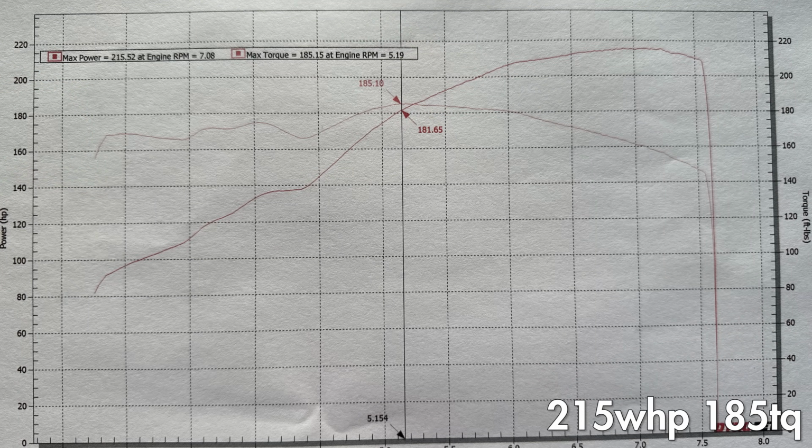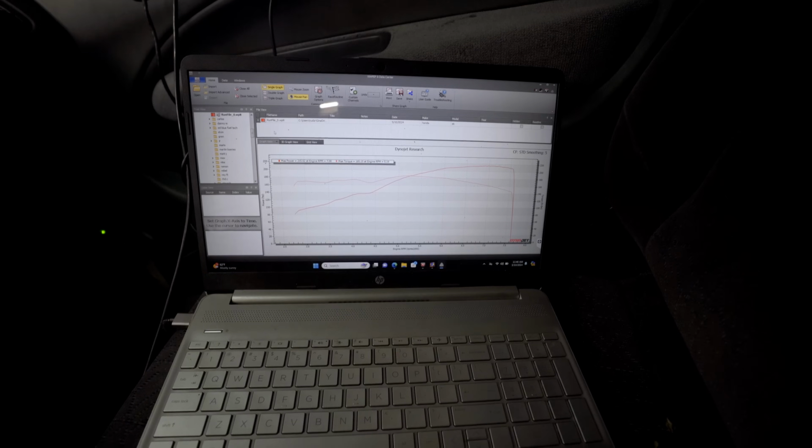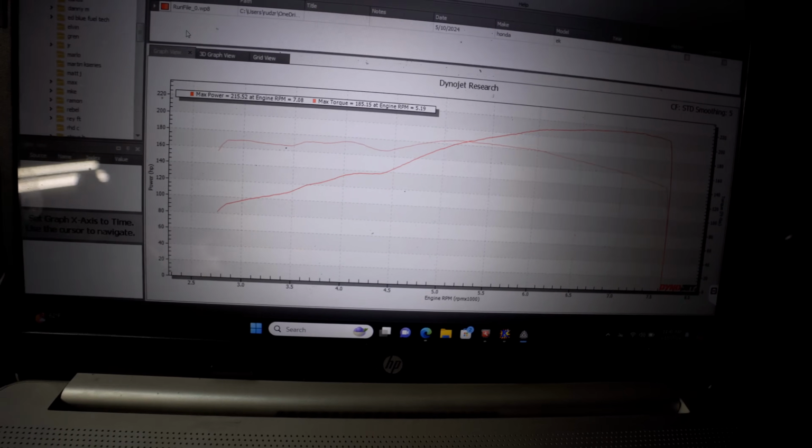God dang, that sounded pretty good there, boys. Dude, VTEC sounded pretty rowdy. You could really hear it crack. That was cool. All right, so that was a stock K24 base map off Hondata. 215, 185 off the deck. I'm not bummed about that at all. That was like my goal for today. It was like 215. The curve is what it is.